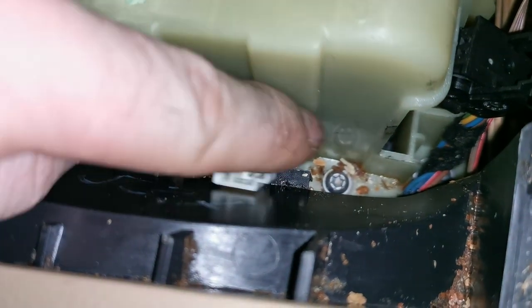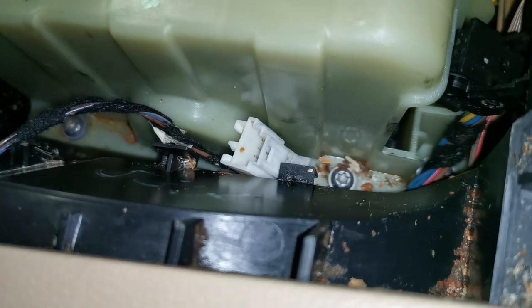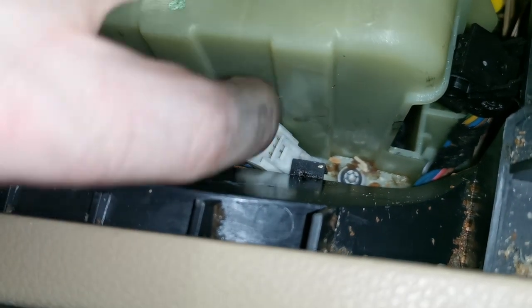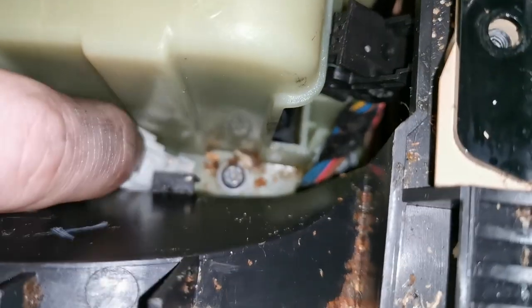Okay, so I pulled the carpet out of position just in that section here and used a trim tool just to push down and pull back, quite straightforward. Then, up the top side, this clip just sits down into that bracket, which you push and then you push down, and then there's another clip on the other end that you just push in and pull up. So that's very easy to remove on that side.